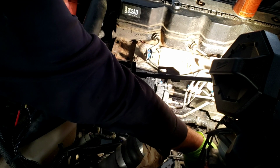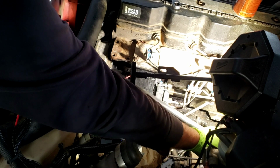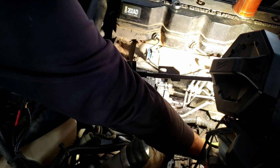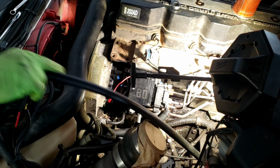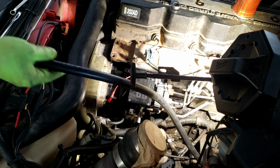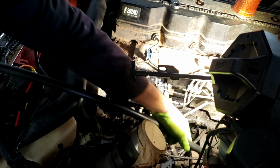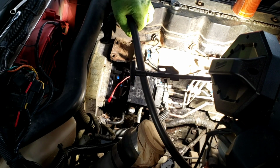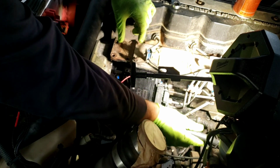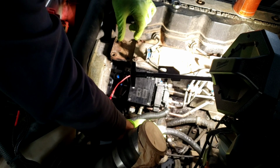So it's probably worth planning on changing these, especially if the truck sits for any length of time. Most of the time in the air compressor world, I get about 3 to 5 years out of some push lock hose, which is pretty good considering the temperatures and pressures they run at. But since you're running at such low pressures and temperatures on this, it may or may not even make a difference.